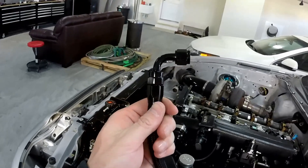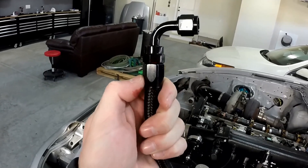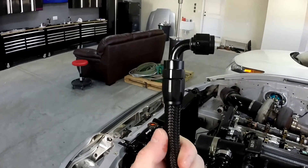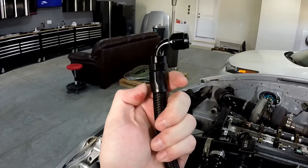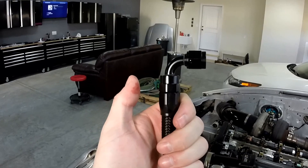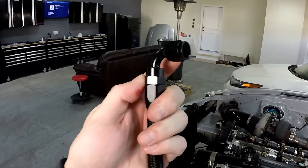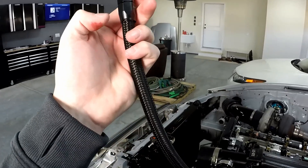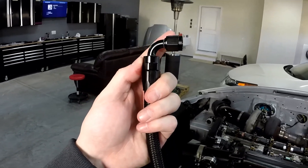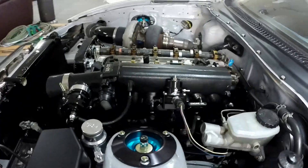I just got the fuel hose finished up. One thing I want to say — this is the Summit Racing hose I have, which is a little off-kilter right now. I need to straighten that out. See how it's all shiny and the anodizing looks bad versus the nice vibrant one my friend gave me? The 90-degree angle is better on the Vibrant, and I could physically tell the actual Dash 6 sizing was slightly bigger than the one from Summit Racing. The finish is much better on it, and the overall quality of the fitting is just much better. I was never a big fan of Vibrant, but now comparing it to Summit Racing, which I know is cheap Chinese junk, I'm really surprised how nice the quality of the Vibrant stuff is. I'm definitely interested in investing more into it.